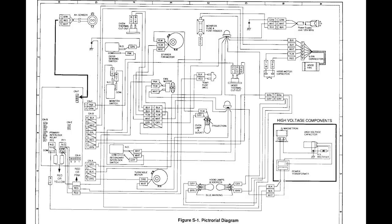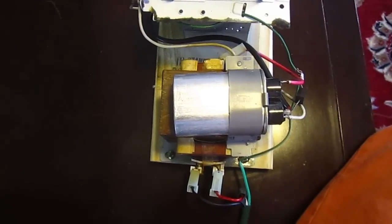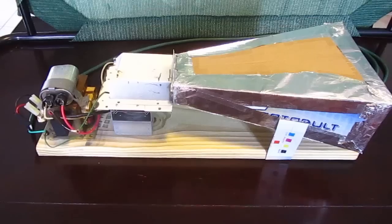This did not help me — this was just a bunch of jumbled gook and I didn't understand it. But thankfully I took a picture when I was disassembling it so I knew what to do. What you do is you have your power input go into the microwave transformer, and that goes into the high voltage capacitor, and then that goes into the magnetron. It's very important to keep everything grounded or else it won't even work.